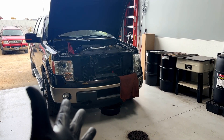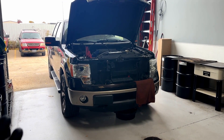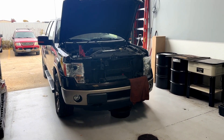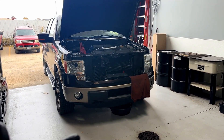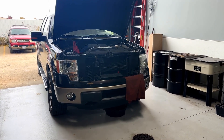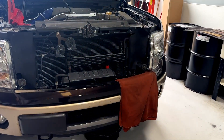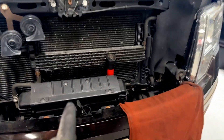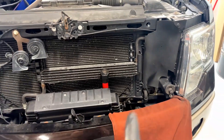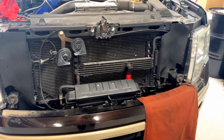As these vehicles are aging, these lines are just snapping and bleeding out, and the transmission will burn up quickly thereafter. By the time you realize you're slowing down or the transmission is slipping, you're already out of fluid and the clutch pack or torque converter is burnt up. Transmissions and labor are not cheap nowadays.